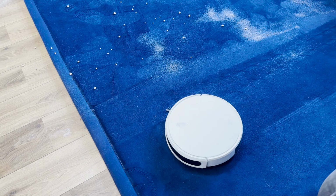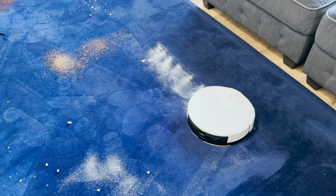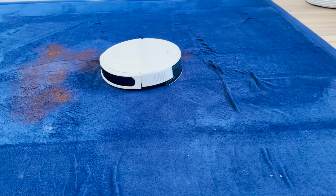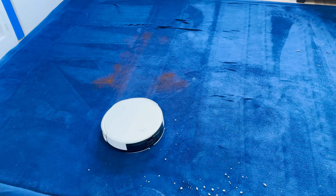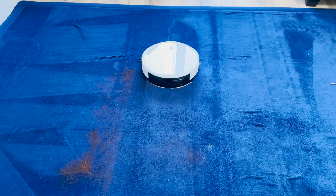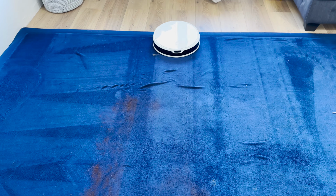The robot is designed to only go towards walls and chair legs and table legs with the side of the brush, because it's using that to brush all the dirt in front of the suction area. My main disappointment was with the popcorn parts. It seemed to avoid them, thinking they are obstacles, maybe too smart for its own good. Then the coffee grounds, that seemed to not pick up so well. They were a bit more dusty than sand, so the particles were much smaller.